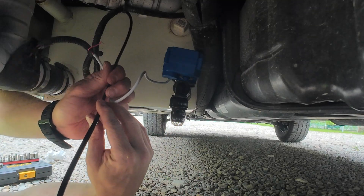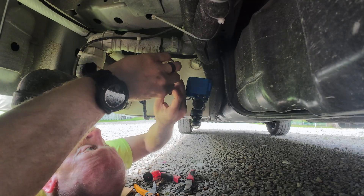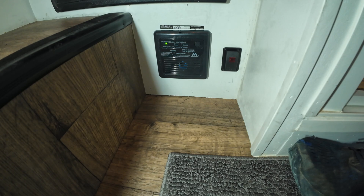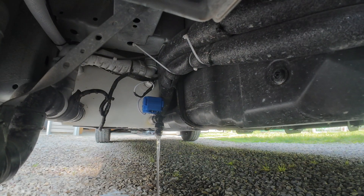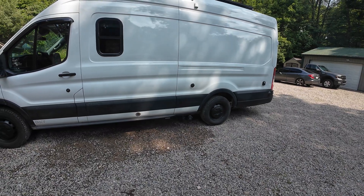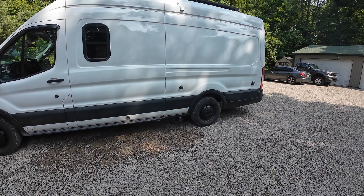I just need to make this wiring connection. Alright, there it is — finished up. Now it's time to put some water in the tank and try it out. Here's the finished switch. We'll flip it and see if water comes out — and then flip it off and the water will stop. Okay, so there you go — with the push of a button we are draining our gray water tank. It's that easy. It's probably a good idea to do this when you're building the van, but I was able to retrofit it without too much of a hassle.